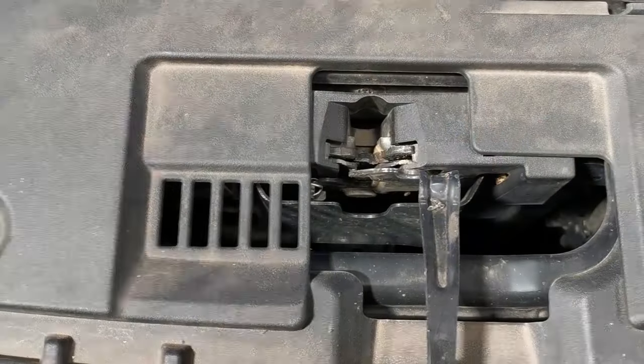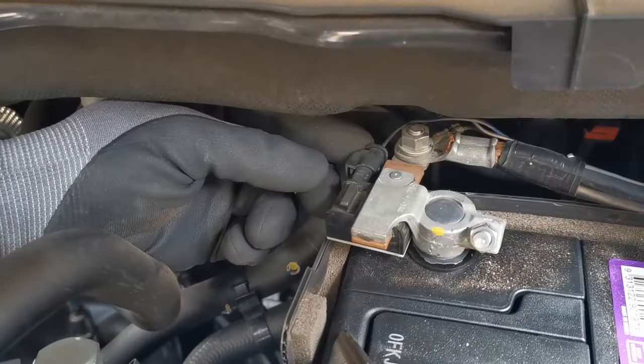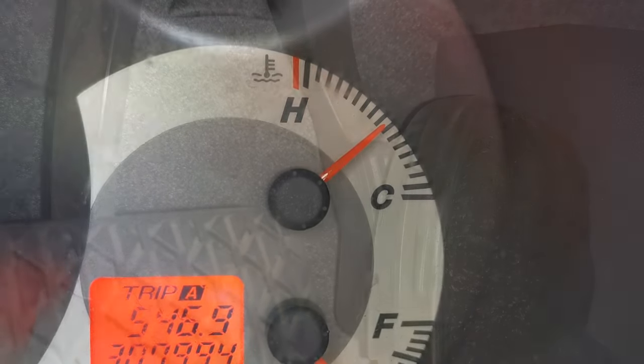It is a monitoring system, so all of these certain inputs need to be active for it to be working: your bonnet latch needs to be closed, your seatbelt needs to be on, the doors all need to be closed and none of them ajar. You're going to need a clutch input on a manual, and a brake pedal input on both types. It's also monitoring battery state of charge, coolant temperature, and the accelerator pedal. There are also a couple of control modules monitoring as well, so this system is quite complex — all of those inputs need to be in play for it to work effectively.